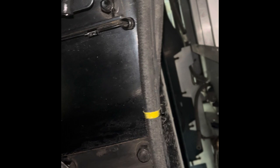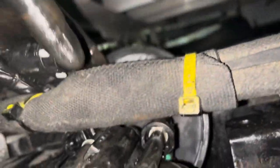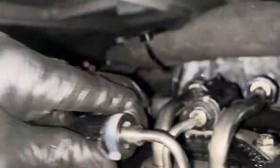That's your sensor. Put your hose — so you have here. The coolant line goes there. You have another coolant line — goes back in the air. And then you have that clip. Then you get the DEF line that comes from the side — goes back in there. And then this DEF line. Get everything nice and secure, make sure, double-check — make sure everything is in there tight, so no surprises.